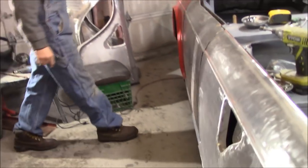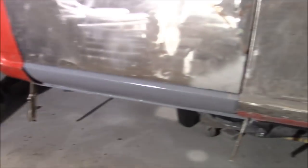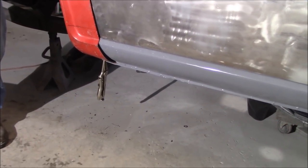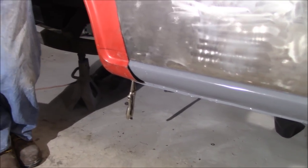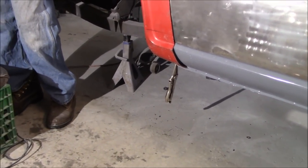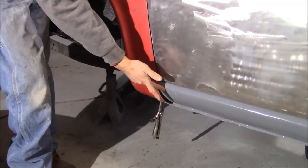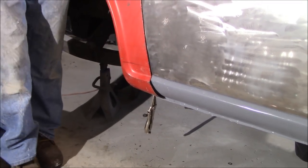So what we're going to do now is work on cutting the bottom of this fender and re-welding that just to make it fit to that sill a little bit better. I know it's not the correct way to do it, but we definitely don't want to have to take the whole sill out and put it back in. I don't think that's going to really help us because we know the A-post is sort of screwed up. We'd have to really go back and reconstruct this from ground zero to fix it properly. So we're just going to make it work with what we've got. The only known good panel we have is the red fender. This is correct, but the sill was installed based on the old fender which was a quarter inch shorter than this one for some reason, and the B-post angle was all screwed up.